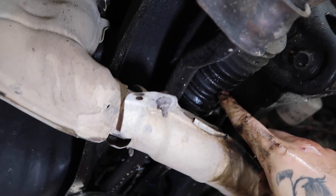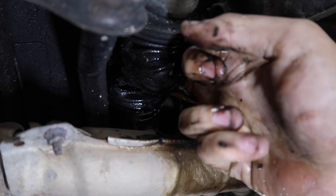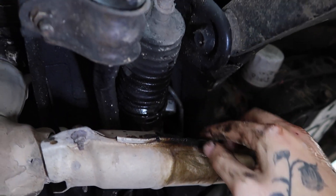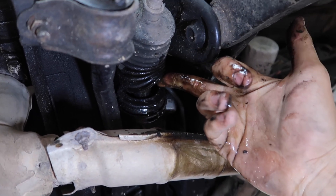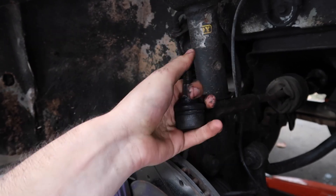Went to take the bellow off on that side and a bunch of power steering fluid leaked out, so we definitely have a power steering leak. This boot's torn and there's some fluid coming out — this is why my Baja smokes so much, because this is all power steering fluid leaking out. It doesn't leak out super bad, but it's supposed to have a little bit of resistance. You can see it just dangles.